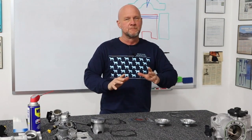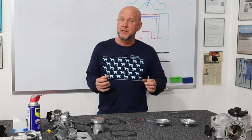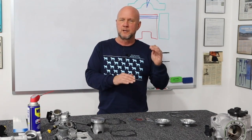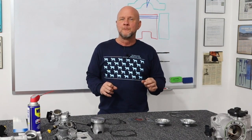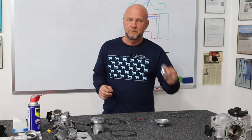Now there are a lot of little things going on with this deal. One of the things that I think is really important is looking at this piston after we took the top end off. When you saw that pic, you didn't see the blow-by lines like you saw in a few of the previous videos when the compression was high — you saw the blow-by go past the first ring and the second ring. This piston is clean, not even past the first ring, and that's after 10 hard runs at that 60 to 61 horsepower. It's been taxed, but now that the compression is lower, the heat is under control and we don't have the issues anymore. So: lower down to go faster.